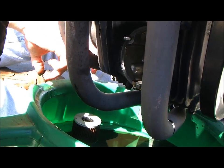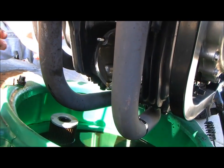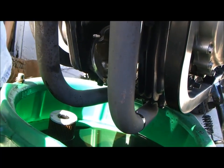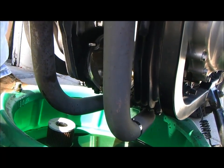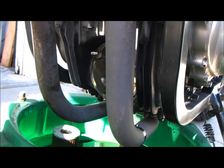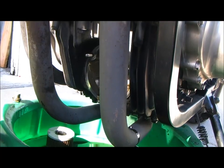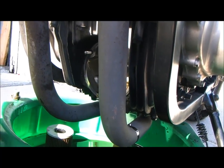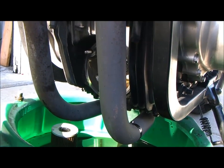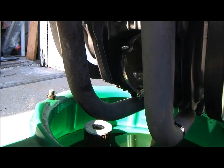If they drive me this month like they say they're going to, I might have the money. I've only got a couple thousand, eight thousand miles on that back tire — it's a 50,000 mile tire. I'll hand you a set of coils — I will not put them on for you at that price. The front two cylinders aren't firing well. She'll fire, she'll do really good over 2,000 RPM. Under 2,000, one coil's cracked — it's testing bad. Travis, hand him a coil and show him how hard it is to hook one up.